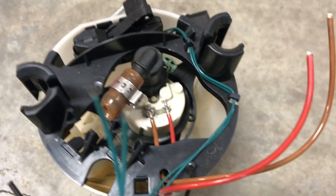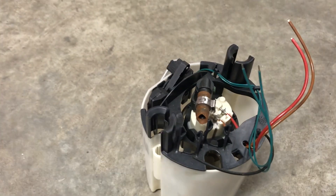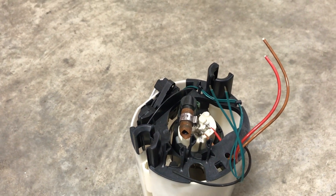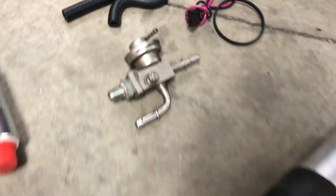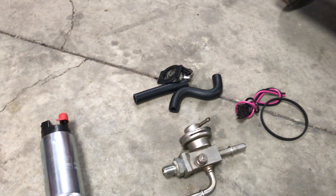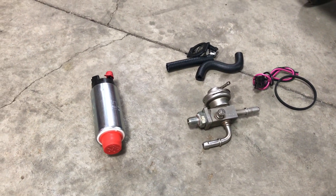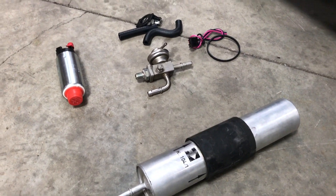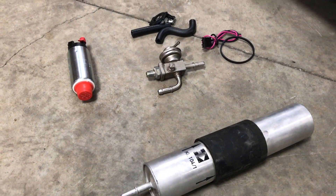The S54 pump is just a regular pump — two wires, red and brown, supplying power to the pump. This is the outlet of the fuel that goes to the engine. We will be substituting that on the E36 with a Walbro LP255. It'll have a regulator and a filter on it from the E46 M3. There are some connector housings we may or may not use, and this will be an in-tank fuel pump controlled with the EKPS fuel pump relay.